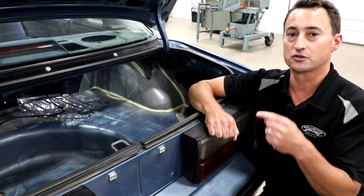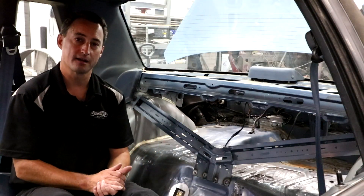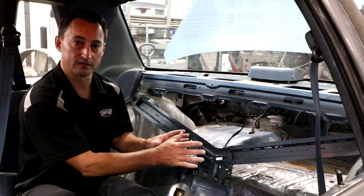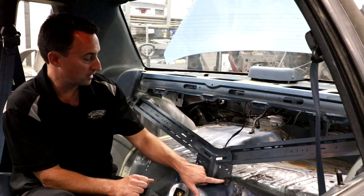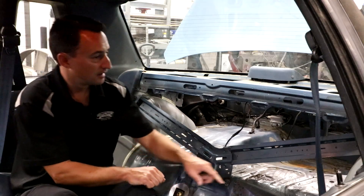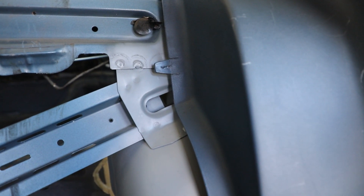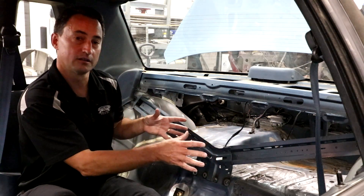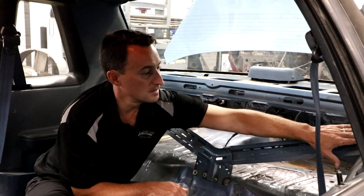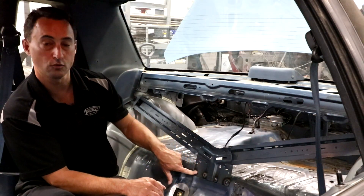For the interior, you need to address the rear seat brace. Remove the whole rear seat brace by drilling out the spot welds at the floor pan as well as the brackets that are originally tied into the factory tub. Once the tubs are installed, modify these brackets and plug weld them back in place to the mini tub as well as back to the floor pan in those four locations.